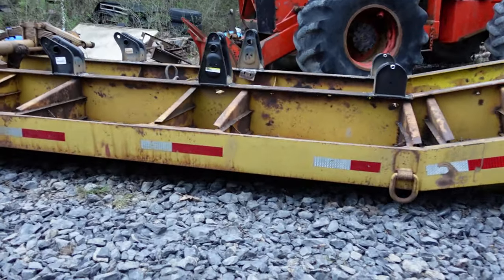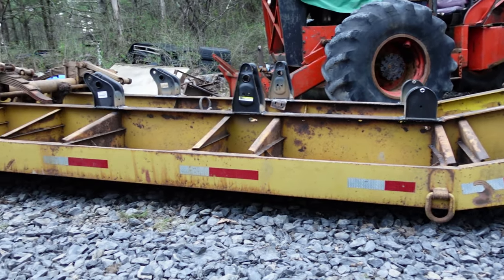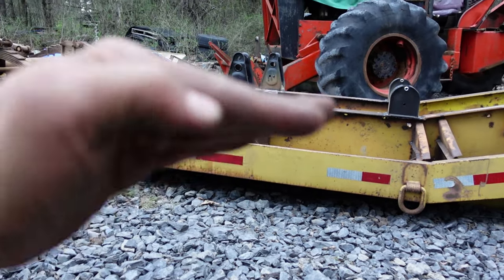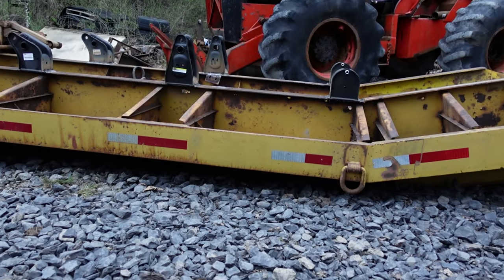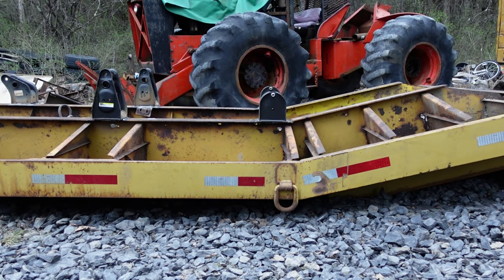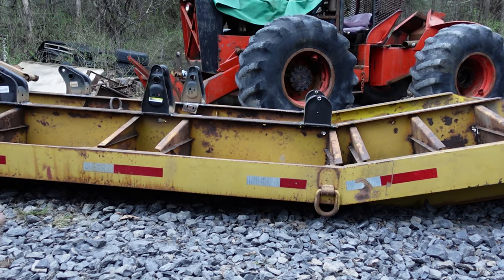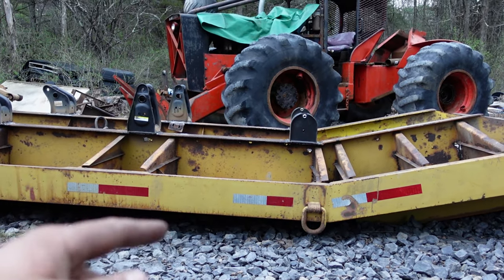If you look down here, there's a few tender spots, so I think what I want to do is take a piece of truck frame rail, because it's got a nice rounded corner, because up in the edge there isn't exactly perfectly 90 degrees. You couldn't really put a piece of angle iron in there. And I could just put a flat plate on the inside, but I think a piece of frame rail would be stronger because it'd come up and go out on the flange.